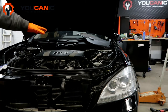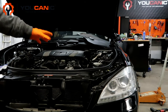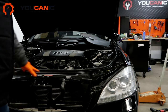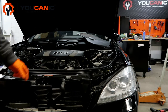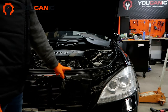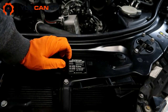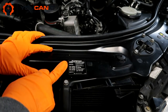If you have a system that is completely empty, the first thing you need to do is remove the air from the system and then put in refrigerant. When you add refrigerant, look in the engine compartment — usually over here or sometimes right below the hood — you will have a sticker that shows you how much refrigerant your vehicle takes and what type. In this case it is right here. You can see it takes R134A type of refrigerant and right here you can see how much it takes.